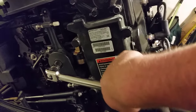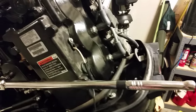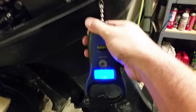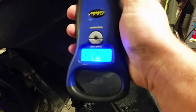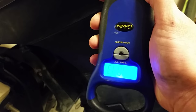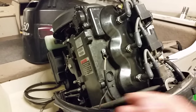To illustrate, I'll hook up to this bolt here on the throttle of this engine. I've got my scale ready to go, and I'm going to hook up and exert ten pounds — watching the display until I reach ten pounds. Boom — ten! Right there you know you've exerted ten foot-pounds on that component, whether it's a spark plug or a bolt. Without a doubt, you've applied the prescribed amount of torque.